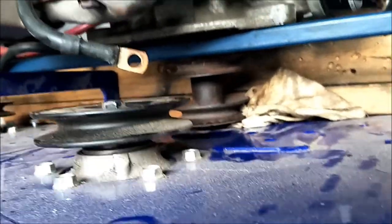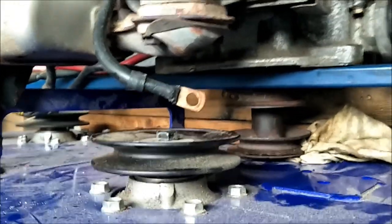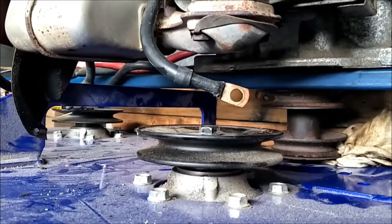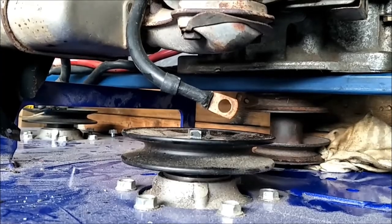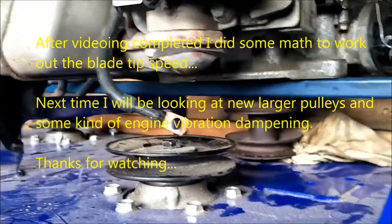With the 20mm box section in place, that pulley is a little low, so by the time I put the engine plate that's on the frame in between here, that's going to lift the engine up. May or may not be enough. So this bar, I may need to get some 25mm bar where I've got the 20s at the moment. The other problem I can foresee is that this pulley is very close to the engine, and I don't think I'm going to be able to get a belt on there without interfering with this bar. So I may actually need another pulley, one that has the pulleys closer together, so I can drive the alternator off the top pulley. But that's another day problem.